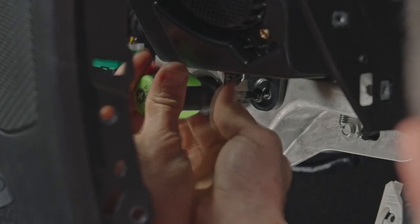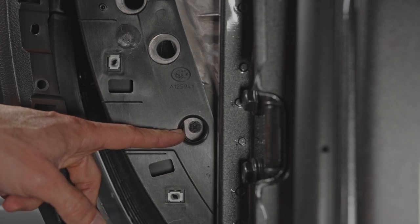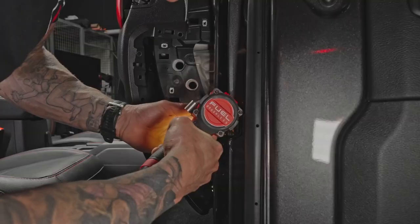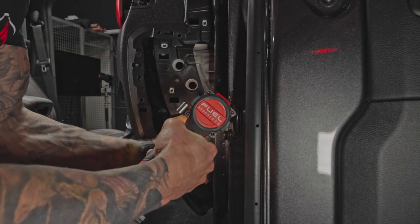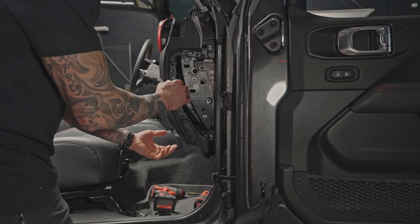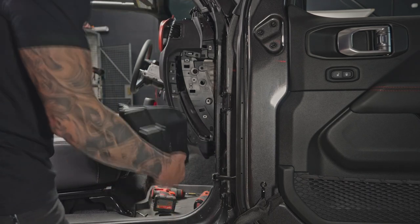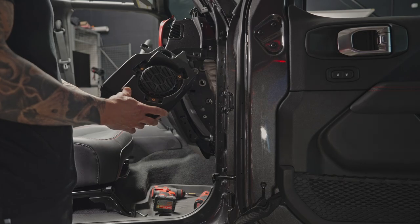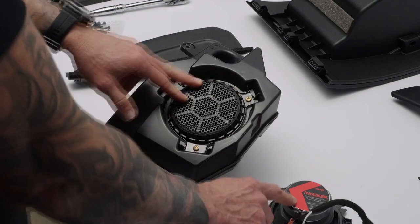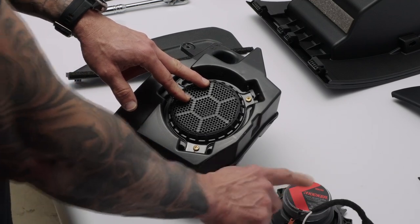The last screw is right in this hole — get in there. Now pull this panel out. The pod has been completely removed, unscrewed, and disconnected, so it just falls right out when you remove the panel. Our pod is out. Now we have the passenger side pod removed with the stock speaker and we're going to swap the stock four-inch speaker for our Kicker four-inch KS series speaker.